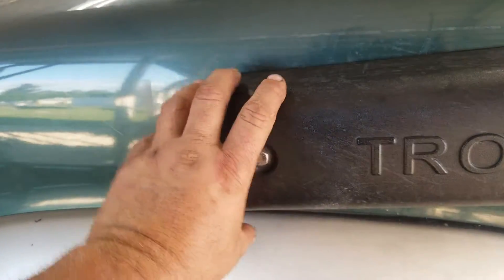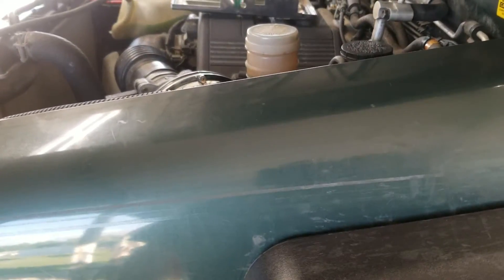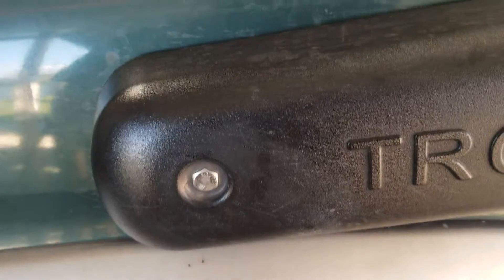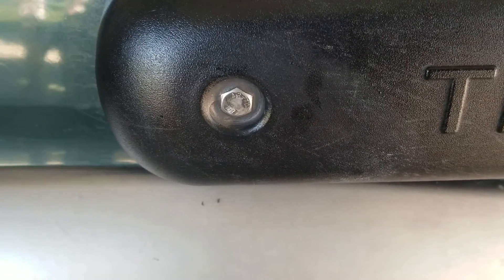I took out the interior fender piece — it's gone, it doesn't do me any good. From the outside of Shrek there's nothing in the fender well from here to here, just a stub remaining. A 3.25-inch silicone tube will fit right over that stub. I used a new stainless steel bolt with silicone and flat washers on both sides and a lock nut.